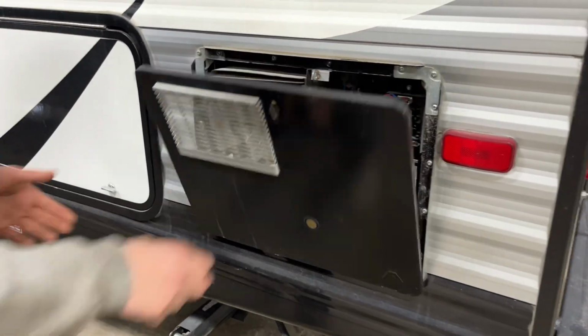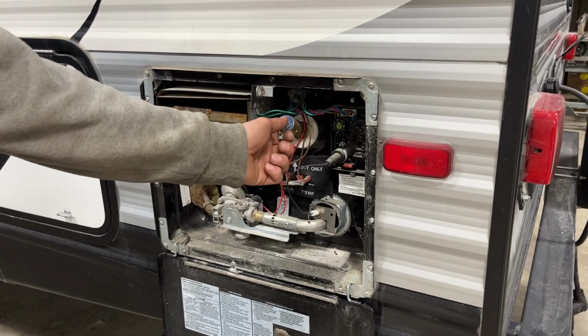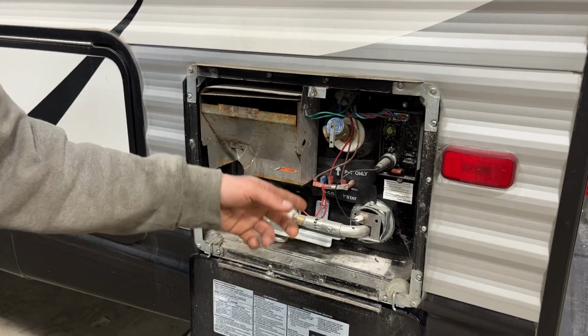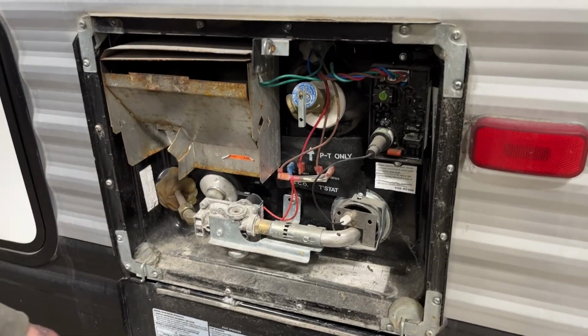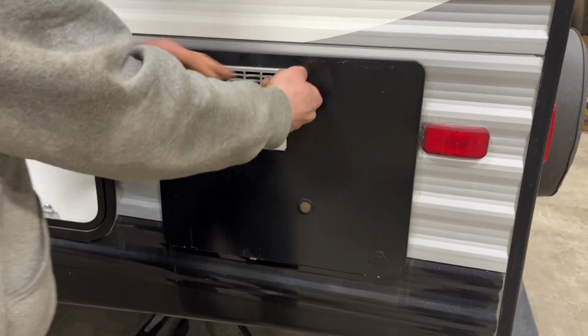Up around the corner from there is your hot water tank. All your controls for turning this guy on are just inside the unit. Before ever turning it on though, with either source, you just want to hit this relief valve right there. Make sure you get some water coming out. No water coming out just means that it might be empty. So of course you would run the risk of damaging all of your elements. So you just want to make sure it's full before firing it up.